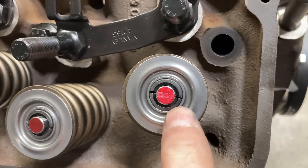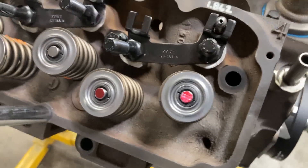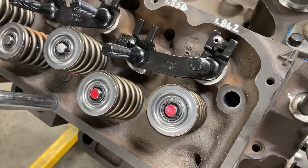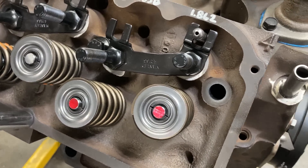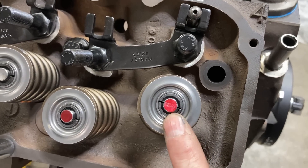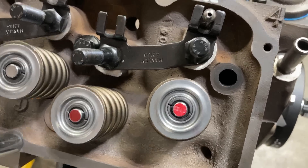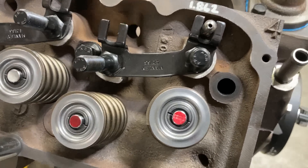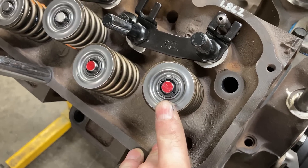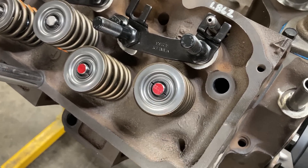There's our pattern — it's near the center but it's kind of wide. From experience, aluminum rocker arms from Comp usually give a narrower pattern, but the steel rocker arms give us a lot more clearance. Now we're going to look at the rocker arm at mid-lift and see what kind of geometry we have.